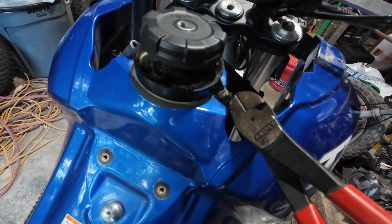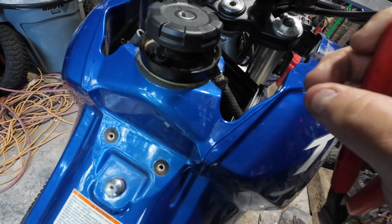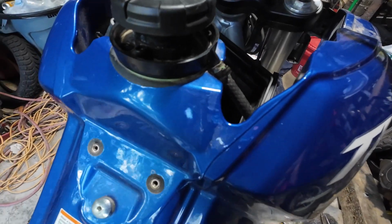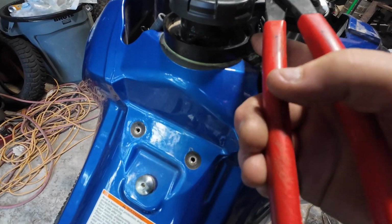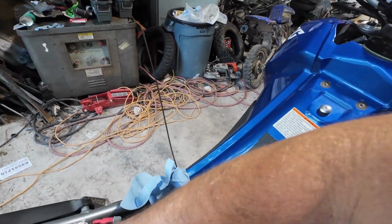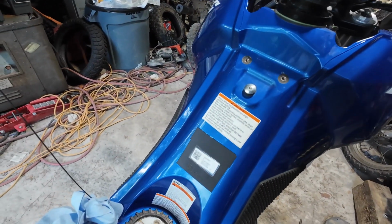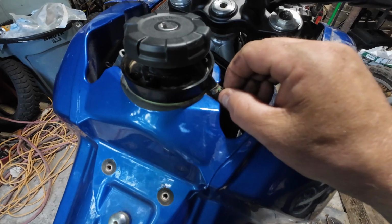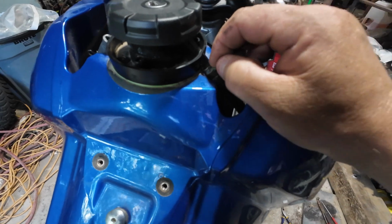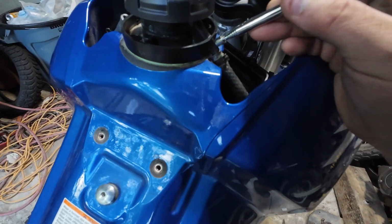You've never had to take these off before? You don't have to have the end crimper pliers that do it like that. You can use just a set of side cutting pliers. The main thing I'd want to make sure of is this plastic or steel. Feels like plastic. If it was steel, you could just grab a hold of it and twist it a little bit and it'll just break right off. But if it's plastic, you'd probably break the nipple doing that. Let's see. Yeah, that's plastic.